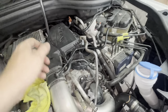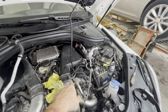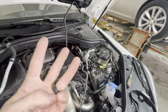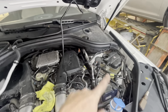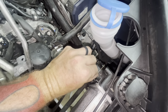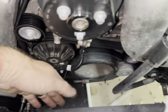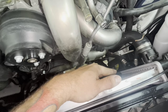Yours is probably going to be brittle. I replaced this in other videos from the accident — you can look back for the part number for this upper line in the rebuild videos. There are only three or four rebuild videos for this Mercedes. That line is very easy to break. Get that out of the way, undo this hose clamp the same way with the little horseshoe clips, pull that off, then you should be able to wiggle it around and get the fan shroud out.